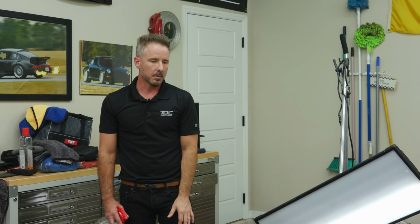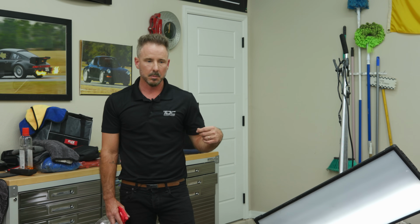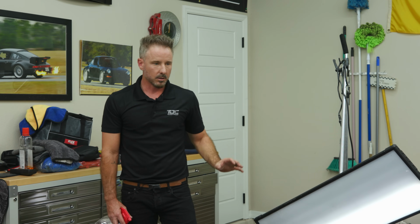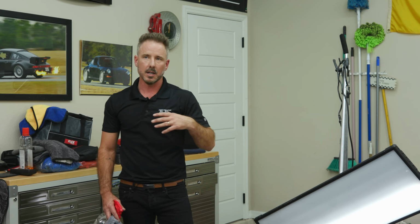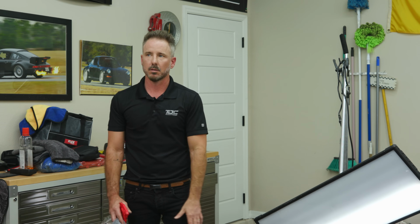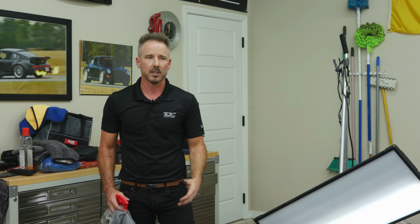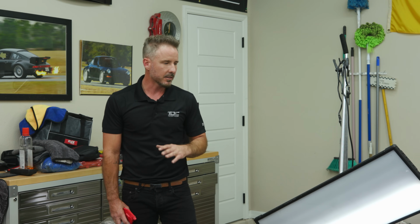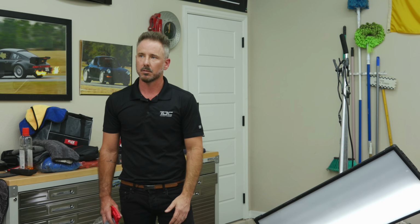When you're doing paintless dent repair, the real interesting thing that you learn, I don't even know if people understand it, maybe this has never been communicated, is you're reading the light, right? Your body guys are thinking about metal. We're reading the light. So yes, we're fixing stuff that might take me 2 days to do and it looks destroyed, but through the whole entire process, parts of it are about the metal, but it's the first 10, 20%. And then after that, it's all about the way that this light runs and passes through the panel and what it's telling you.